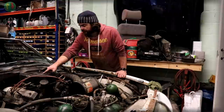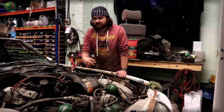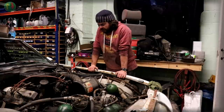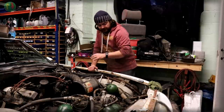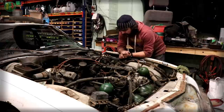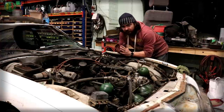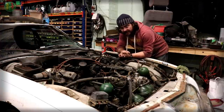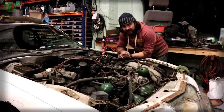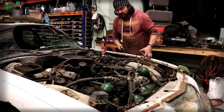I'm going to start by pulling off the air box and this plenum chamber - inlet manifold, I suppose. I notice it has the cylinder numbers on it: one, two, three, four, five, six. We've got triple carbs - triple Weber DCNFs I think - and they look and sound very pretty when running. I'm not keeping them of course because it's not 1972 anymore; I'm going to figure out some way of fitting fuel injection to this. And look at that - the fixings on this car always look like they should never come apart again, and then they just come apart.